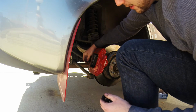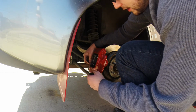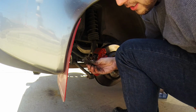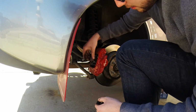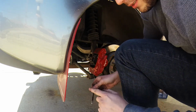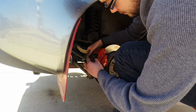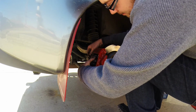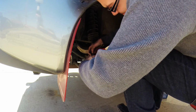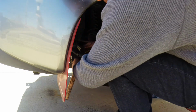Same principle through the back side. Stick that in, line up the holes, stick it in now. Put some lube here on the inside. Now this is just a mini version of that front spring. Goes underneath the center piece like that. Put your lube on here. Feed that through. Push this down. Hammer.